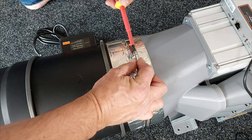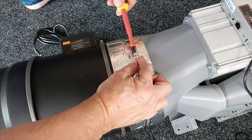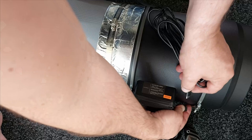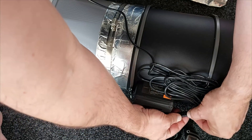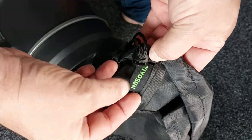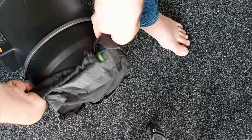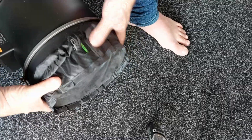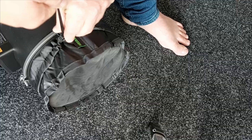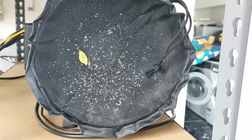I found when tightening up it gets tighter and tighter and it just suddenly stops, so that's when I tend to stop — there we go, it just doesn't want to tighten any more. Now we plug in the USB cord from the Nord controller into the AC Infinity fan and we're pretty much all done. The other thing I put on my units are these VivoSun coarse filters over the inlets, just to stop bugs and other things being sucked in. These filters are washable — you just rinse them out in water. They do catch a lot of bugs; this is an example of one of the other filters after just one month since it was last washed.